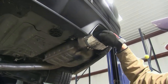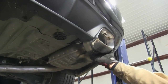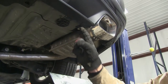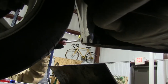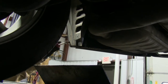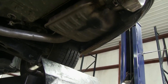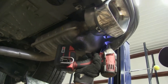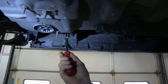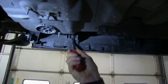There are some fasteners on the very bottom edge of the bumper cover that we need to remove. This gives us flexibility in the bumper cover so we can lower the exhaust as much as possible. There's one inside the fender well, two screws on the passenger side, and behind the bumper there are brackets going up to the bumper structure — we'll remove those plastic rivets as well.